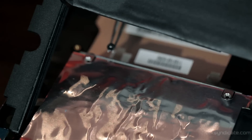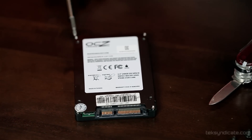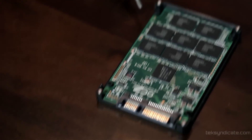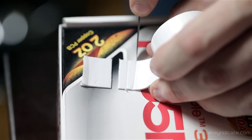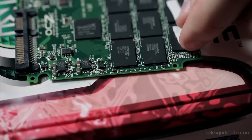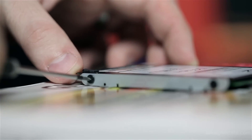Pull the battery up — note that a ribbon cable is attached to the bottom of the battery, so be careful. You don't actually need to pull the battery all the way out; just remove those two screws to access the hard drive. Now we take the OCZ apart — there are four screws on the drive. Remove the PCB from the housing. We're cutting some thick double-sided tape and placing it on some of the memory chips to give a little lift. If your SSD is smaller than 7 millimeters, you don't have to do this.